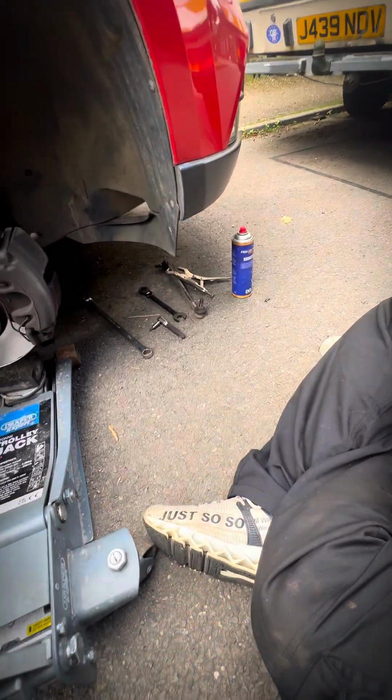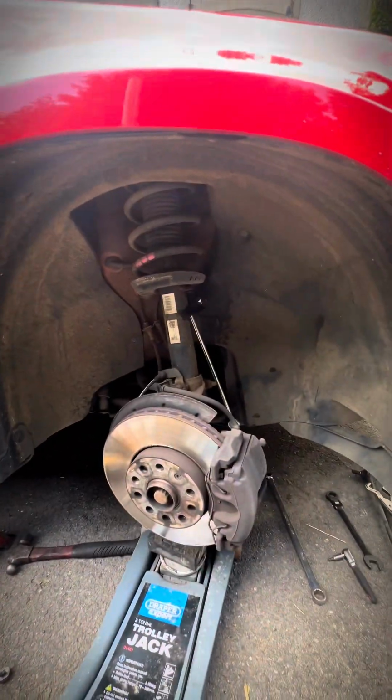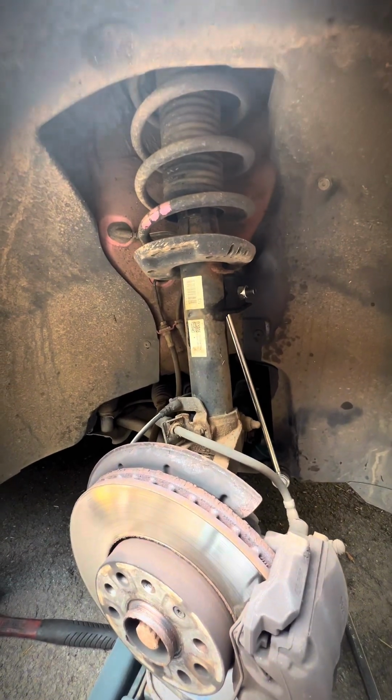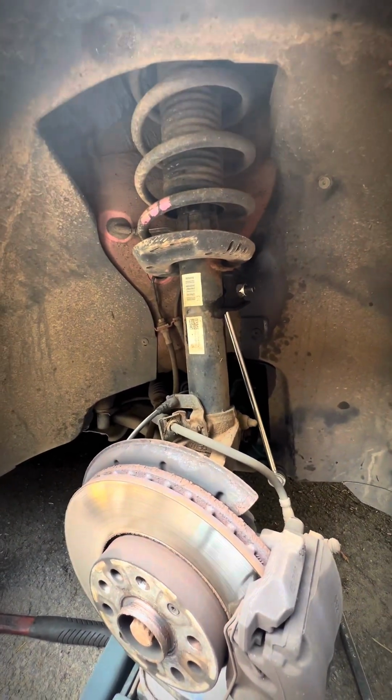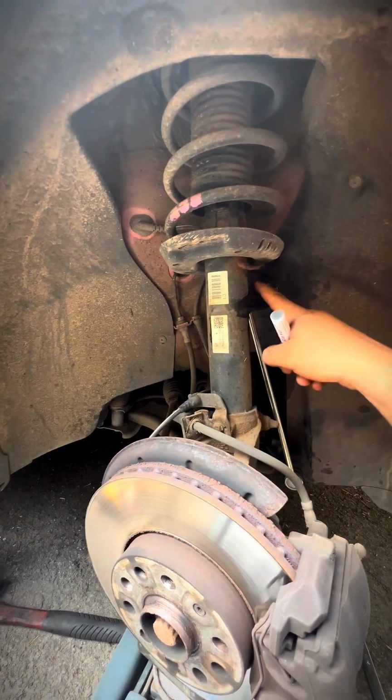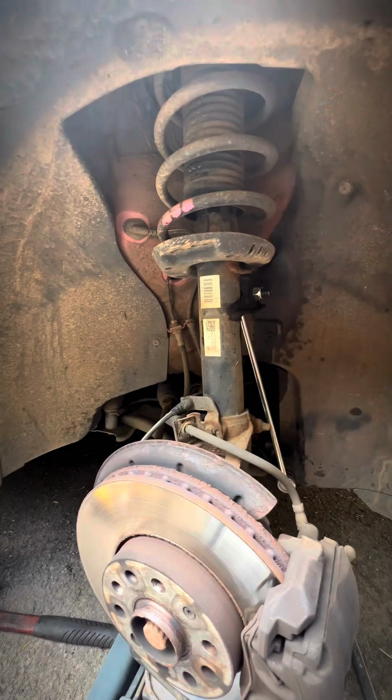And then you have to paint it so you know that you've done it properly. Just put a little bit across the nut, the thread, and where it's mounted on the shock. Then if it moves, you can see. And if it's been tampered with, we can see. Just a line across the 3 parts.